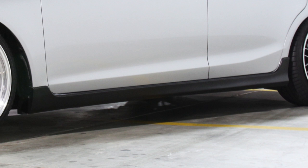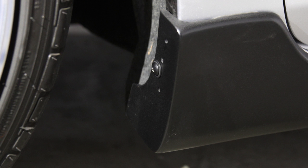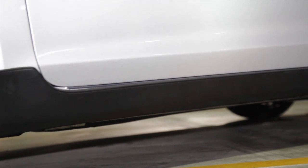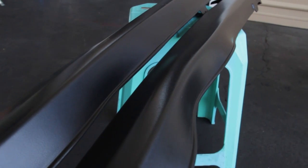For the fenders, there are seven mounting points on the side skirts. Two in the back actually have to be drilled into the metal fender — take your one-eighth drill bit and drill right into it, making sure the hole is nice and straight. For the front, I was able to reuse the holes from the mud flaps that were previously there, drilling straight through and bolting it right up. For the bottom, I only used the center mounting position so I could let the kit settle into the body of the car, since it was a little warped and I wanted it to sit in the sun and take the natural shape of the car.